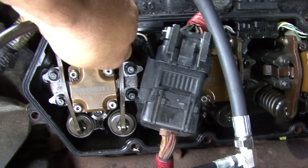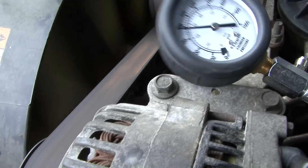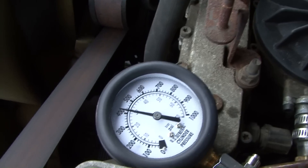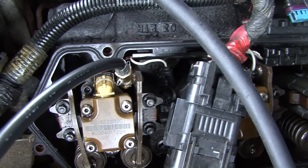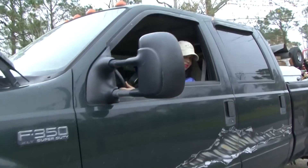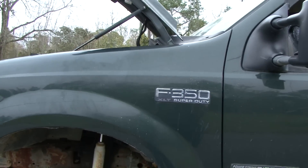Keep going — alright, stop. This one's a good cylinder — she's over 400 pounds of pressure, and the coupler worked absolutely perfect. Hope that helps you guys. We're going to call it — hope you enjoyed the compression check walkthrough on the F-350.